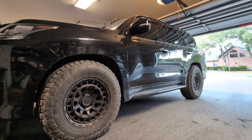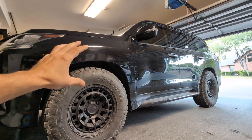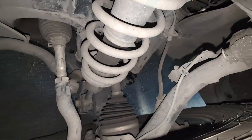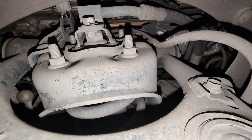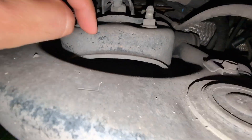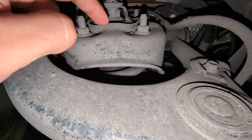The easy way to do that is in the front. In the front, you have a strut assembly — it's a coilover strut. There's your coil spring that goes from the bottom, has an eyelet that bolts down there, all the way to the top. It's got a four-bolt mounting plate at the very top that attaches to the body mount right here. What we're going to do is put a 10mm spacer underneath this body mount and right above the perch — the top plate of the strut assembly.